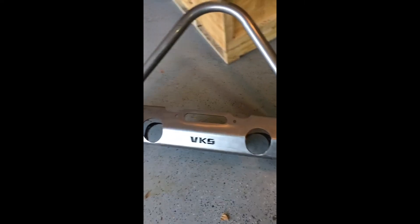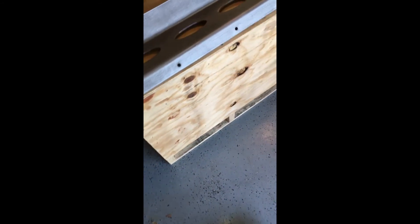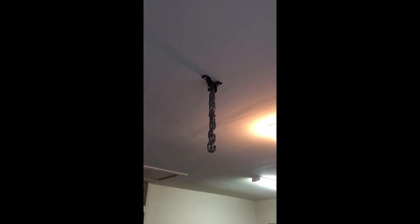Next obviously is the bumper. I'll go through and get it all touched up how I like it. Hopefully I'll have time to go ahead and get my first coat of etching primer on. Etching primer usually only takes one coat — it's not going to etch back into itself. I've got a nice little punching bag hanger that I can hang it from. I'm going to mask off a big area here in the garage so I don't cover all my other stuff with paint. The next video will probably be after I do the first coat of etching primer, just to kind of show what I'm talking about.